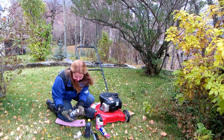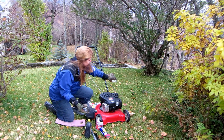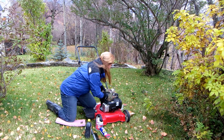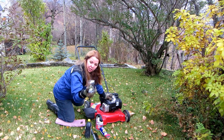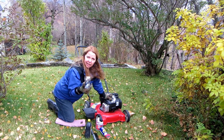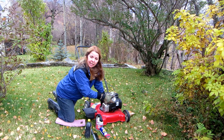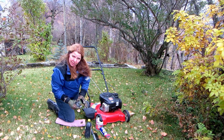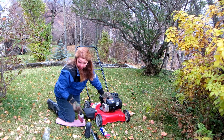What I did is I cut a soda bottle in half, and I'm going to use this half as a funnel. I measured on here how many ounces of Stabil is required for my machine. Then make sure that you run it for at least 5 minutes so that the stabilizer gets all the way up into the carburetor.